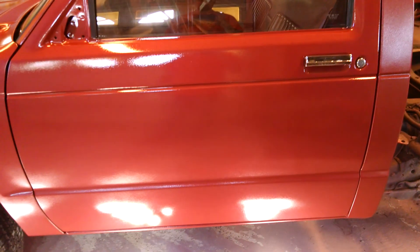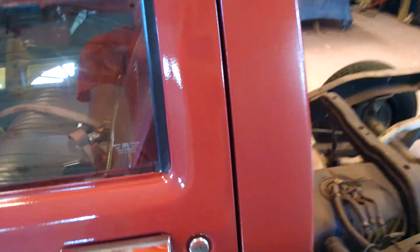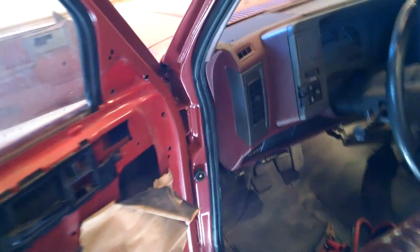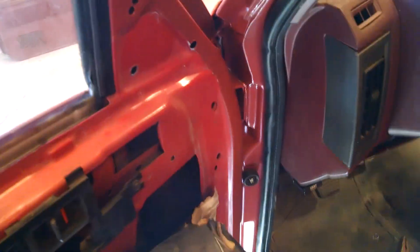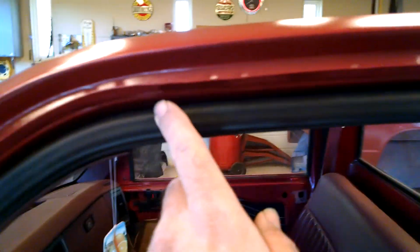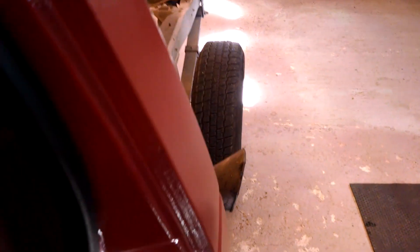You can see I painted the doors separate from the truck. There are new pins, bushings, and springs in the doors — what a pain, but we got them in. Got all new weather stripping put on there. Back here I just sanded it down a little bit where I put the cab corners in and primed it, and sprayed a little bit of Rust-Oleum paint on it to keep the welds from rusting.